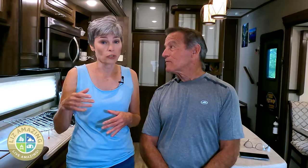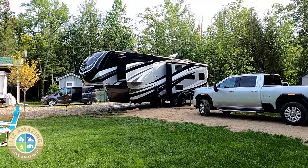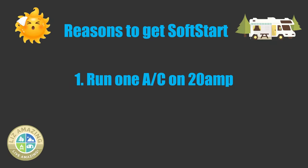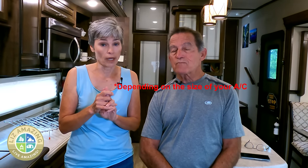We did a video last year about the wired-in soft start product called Soft Start RV. What soft start allows you to do — whether you install it in the air conditioners or use the plug and play Soft Start Up — is driveway dock and run an air conditioner. You can run two air conditioners on 30 amp. With big rigs that generally need 50 amp, you probably wouldn't be able to run three ACs on 30 amp with soft start — you'd have to choose which two to run.